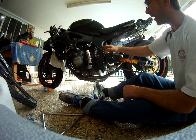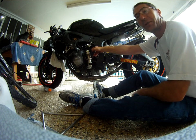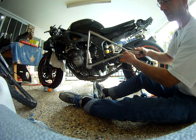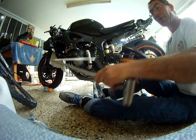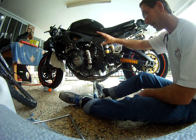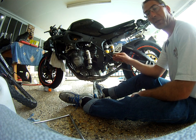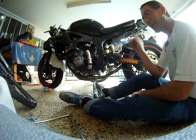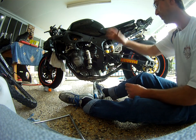If you put too much stress and pressure into this system, you can bend the selector forks inside the gearbox. It's a little fork-shaped part — it's a $20 part, not a problem. Unfortunately, it costs about $1,000 to strip the bike down, get the engine out, separate the engine and straighten out or change the selector forks. It's not the part that you break that costs a lot — it's the labour and the amount of other stuff that has to come apart.